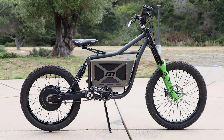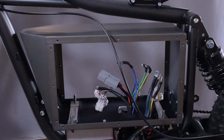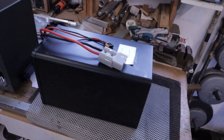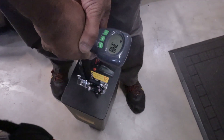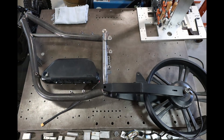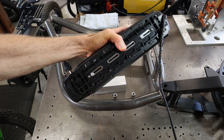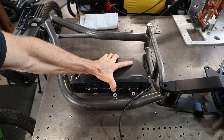This is another version of the same bike I just made for a customer that has a smaller battery pack. I shortened up the battery box area so it's not quite so big. I went with a 72-volt, 45-amp-hour pack in this bike that I also got from Booant, except this one is one of their metal-encased batteries instead of their shrink-wrapped batteries. This 3.25-kilowatt-hour battery weighs in at about 34 pounds. Currently I'm working on building another one of these bikes using a standard e-bike battery and a 750-watt hub motor, so it will be lighter and legal to ride without a license.